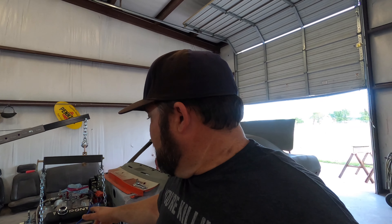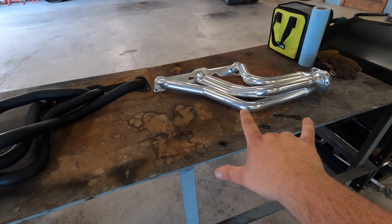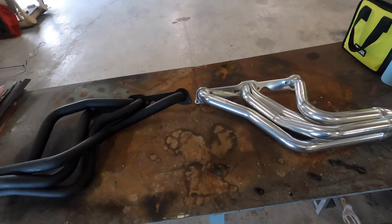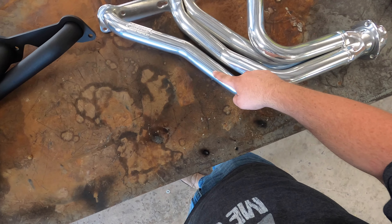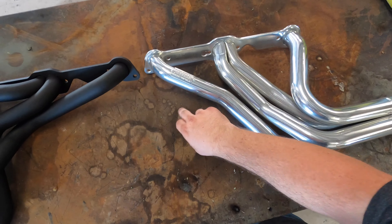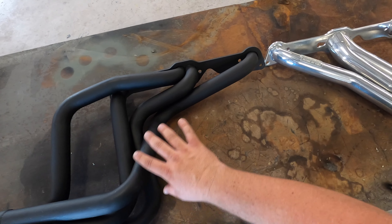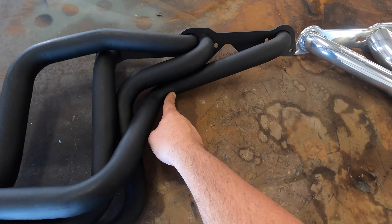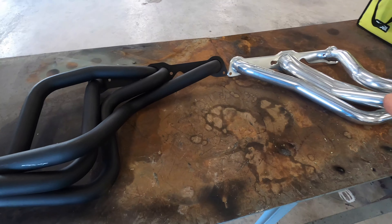From that clip, the header was in the way and I thought I was going to have to modify the frame. I did some research and looked at different headers — here are the ones I purchased first, I should have done the research right away but I was too excited. You can see from overhead how this one goes straight down and comes at this angle. That's where I was having problems with the steering linkage hitting. These other ones I got straight from Jegs — just painted, I'll get them coated — and you can see the major difference: they wrap all the way around and leave that area clear for your steering.